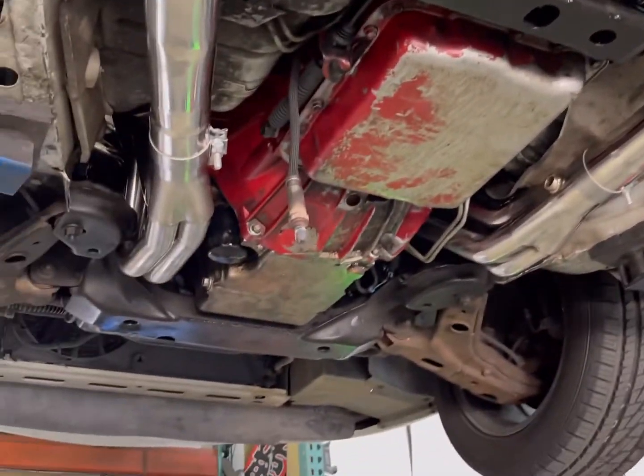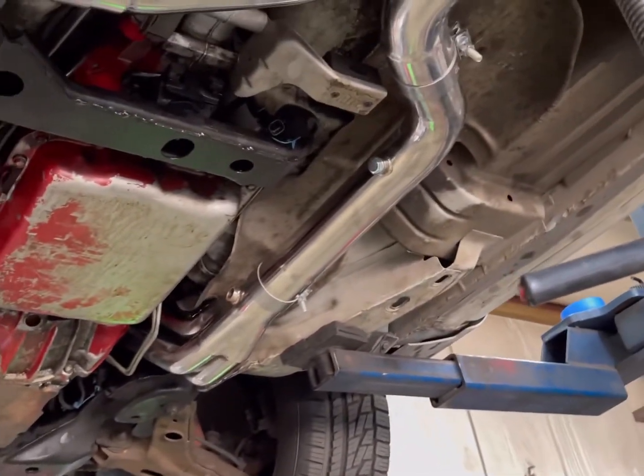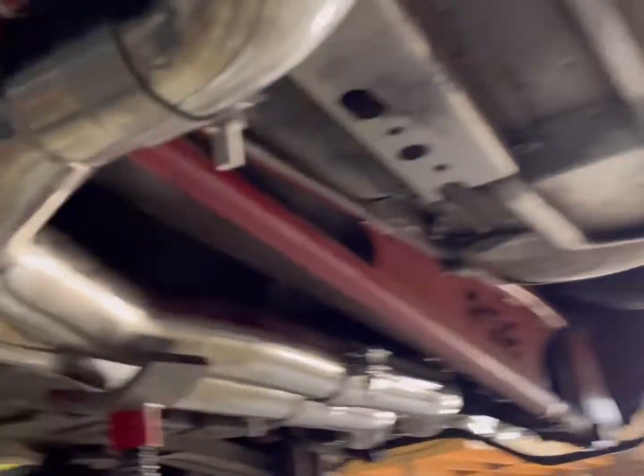All straightforward, just pull the kit up online and follow how they have it. Put all the pieces together, don't tighten anything up, including the headers, until you get everything on, because the bolts are slotted up there. So get the whole exhaust on right now, then push it up where it needs to go, and then you can tighten the back header bolts and they'll stay, they won't sag at all.